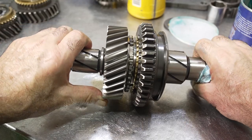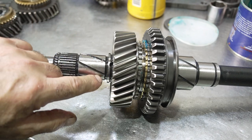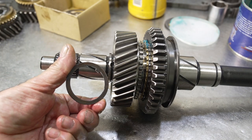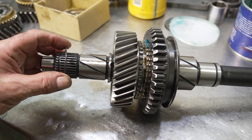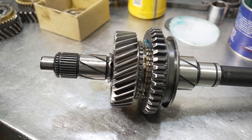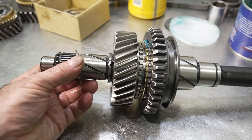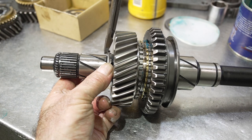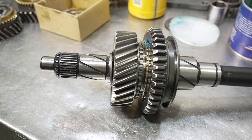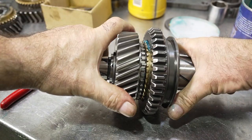I'll flip this around — there's a little hole here that the first washer goes into, and then the other snap ring for the 1-2. The tang washer's tang fits into this hole. I'm going to put the second gear snap ring on. As I've mentioned in several of my videos, snap rings do have a direction to them. That's in there nice.